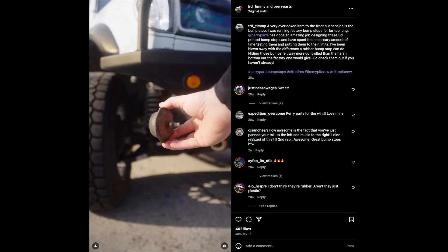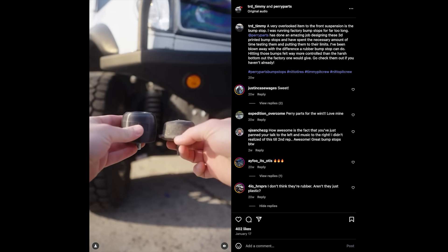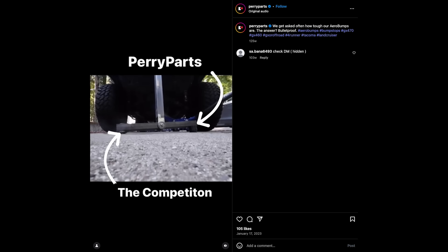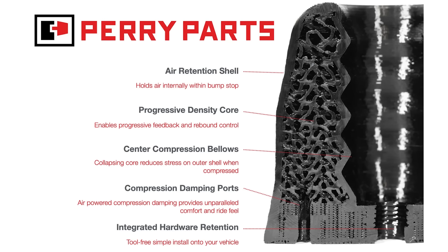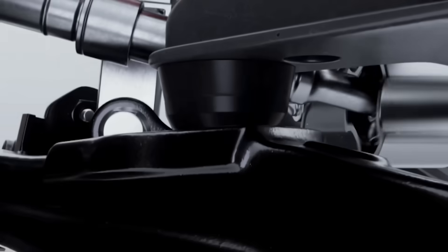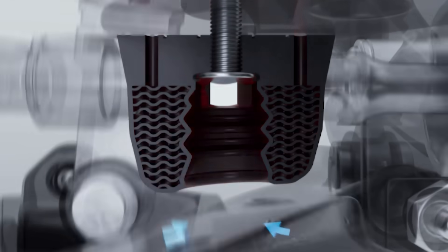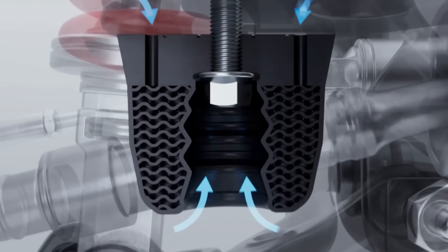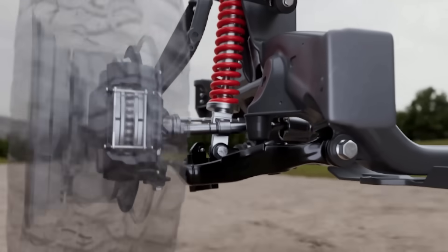Perry Parts takes full advantage of 3D printing. Where all other cars generally have a solid rubber cap that doesn't really compress any more than rubber compresses, Perry Parts is able to completely move beyond that and dynamically change how the part behaves. Instead of having a solid brick of rubber, they change it so it has an internal spring. They are able to use custom designed, CAD engineered infill so that as the stops are compressed, the infill progressively gets harder and harder and twists, bends, and compresses. The part is not just squashing material — it's squashing a mechanical mechanism that controls the material: where it goes, how it spreads, how it breaks. So you get a lot more durability and a ride feel and bump stop behavior that is way more gentle on the material and leads to a better ride.